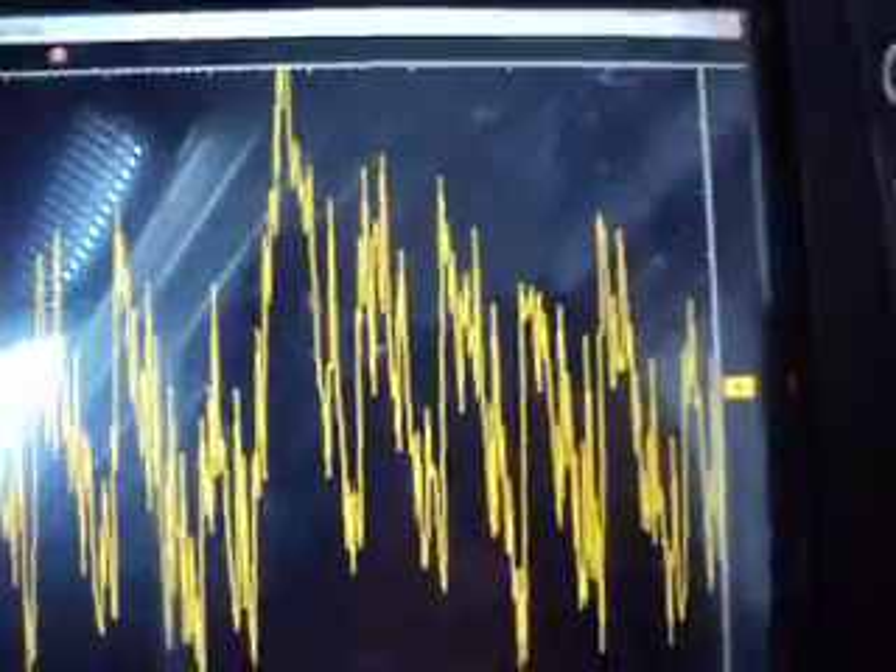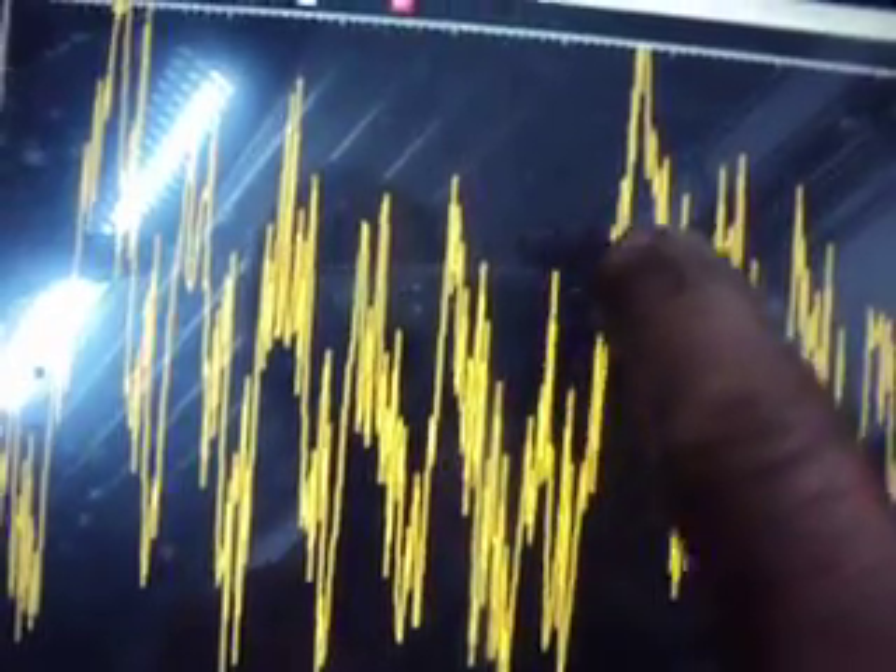So what I did was a relative compression test with a low amp probe. You can see by what we got on the screen here that things aren't looking too good. We got a low cylinder here, and when you get a low or weak cylinder, the next cylinder in line will take up extra amperage to keep up the momentum of speed that you picked up when you hit the weak cylinder. So we knew we had a weak cylinder.